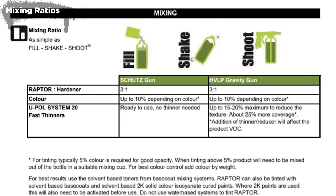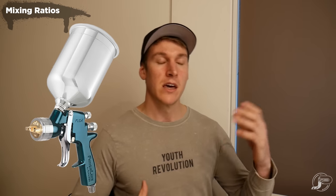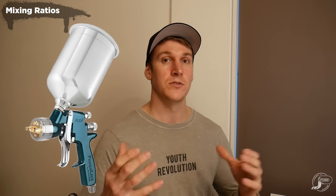Now it's time to mix the Raptor Liner. It's a 3:1 mixing ratio of hardener — that's all written on the box and the hardener is supplied with each kit. If you're tinting Raptor Liner, it's a 10% tint ratio; just follow that with a measuring cup. Some people talk about using gravity fed guns to get different textures — that's not a bad option, but you have to thin it down, which can cause durability problems. For interiors or non-impact areas thinning is fine, but for four-wheel drive bar work I wouldn't recommend it.